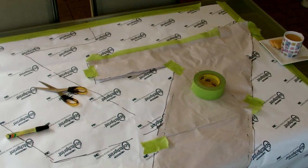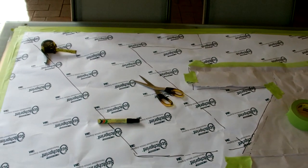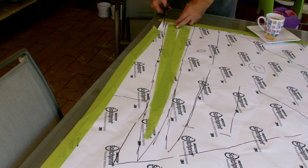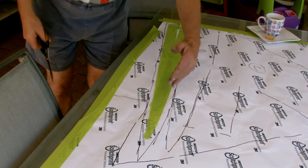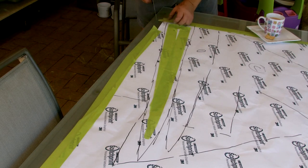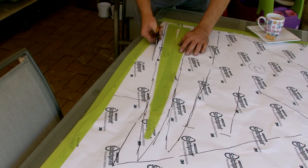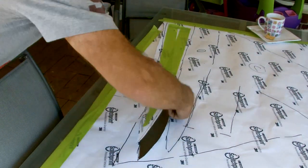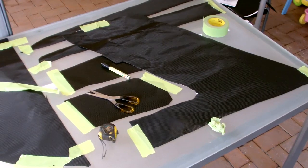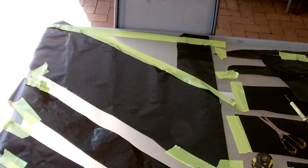In this particular case, the shape of the previous work on the car must also be matched. Cutting out basic paper patterns and laying them out on the vinyl before I cut anything out is a first step that will address these application issues. Only one set of patterns is required because the other side is basically just a reverse. Now I've got all my pieces laid out with the patterning of the grain going the right way, I can roughly cut them out. I've marked them all oversized.